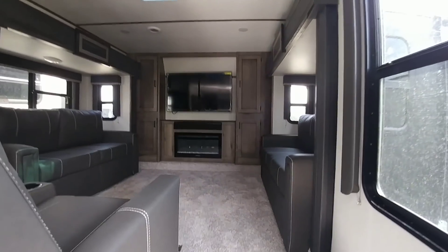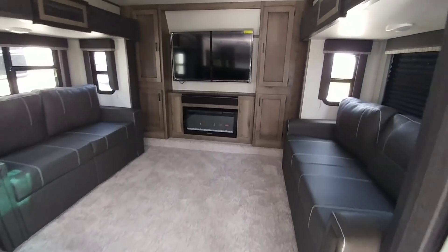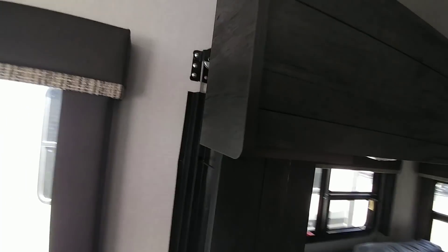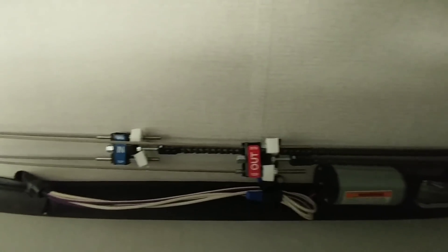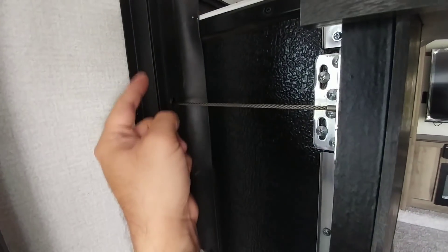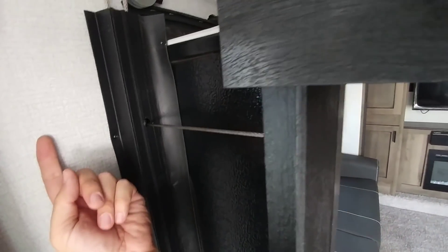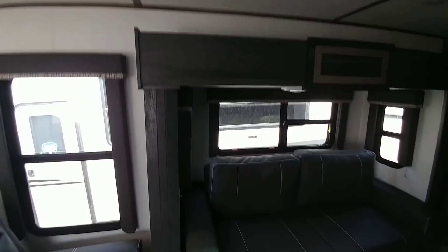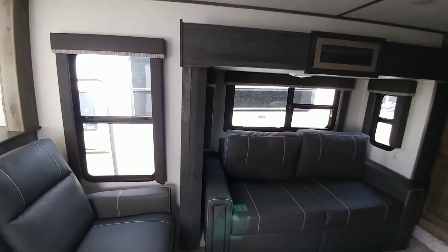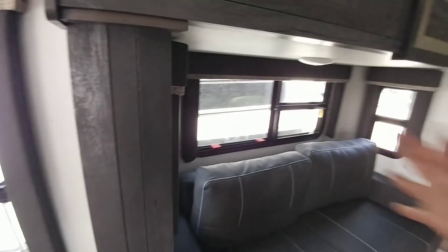So this is a front living room model. They do not have that slide fully extended because there's another fifth wheel directly outside of it, but this does give me an opportunity to show you what the cable-driven slide mechanism looks like. You can see here that it's essentially a bunch of pulleys and cables. Each side has cables that go down and out, they make a hard turn here, and you have cables that are either pulling it out or pulling it in. They go down and split off at the top and bottom, and this entire slide is kind of in its own frame structure. Adding this type of slide to a fifth wheel is pretty easy — it's a lightweight system. These two slides are relatively light, so that's probably not that big of a deal.